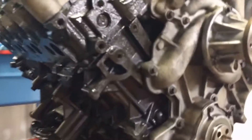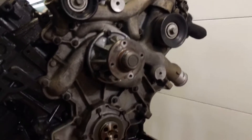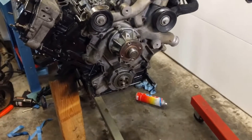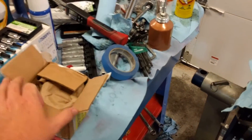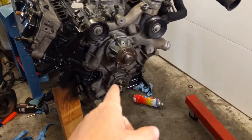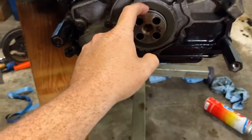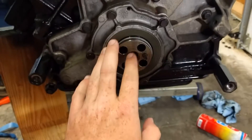It looks really good. I don't know how long that paint will last, but it's supposed to be high-temp engine paint so we'll see. That front seal right there — you have to have the special tools that diesel techs like Ron and everybody talks about. Freedom Racing makes them. I actually bought mine because I hated to spend around $200 to rent them plus shipping. I bought the one for the front seal — super simple to install. You bolt the alignment piece on, slide the seal and wear sleeve on top, then crank it down with the nut until it stops and it puts it in perfectly.